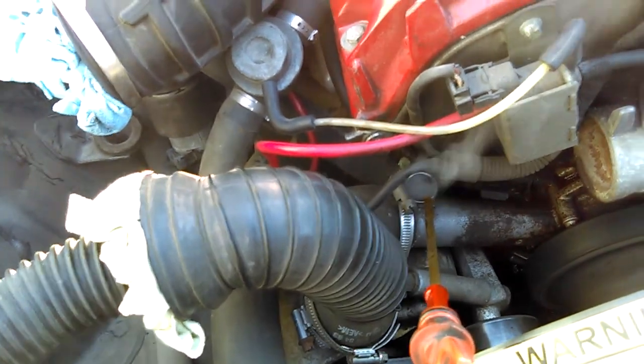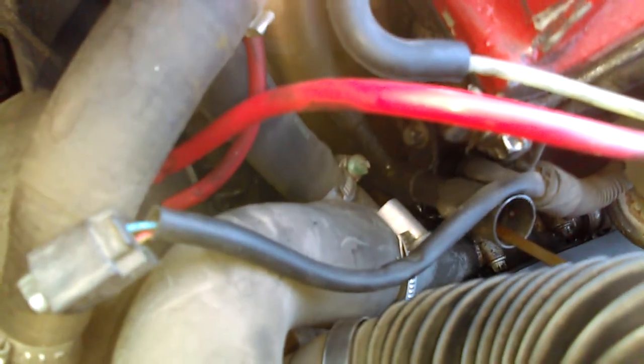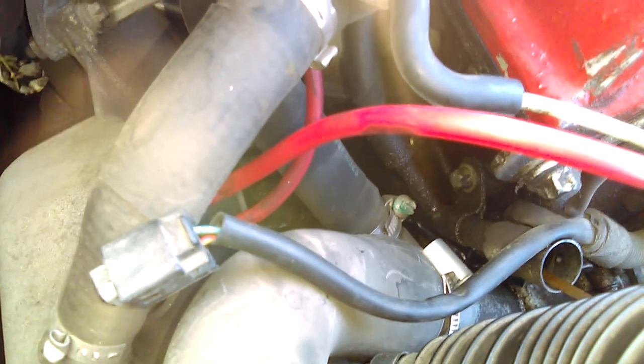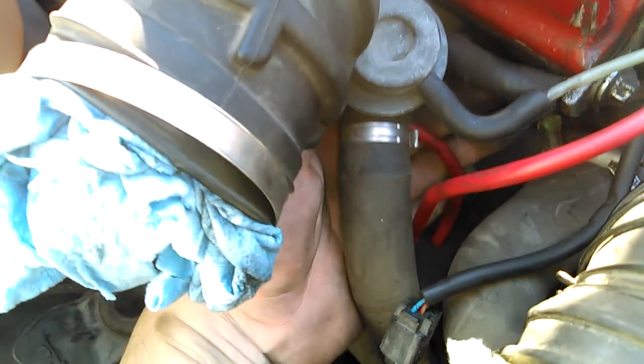It's the only place I see smoke coming out of the engine now, is there. And looking closer, I can see — if I can get the light to turn on — I don't want the camera to get in there. On the neck of the dipstick is a hose, and it's looking pretty oily. I wonder if I disconnect that hose and see if that's where I'm going to get my smoke from now.